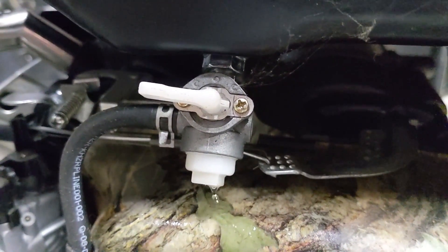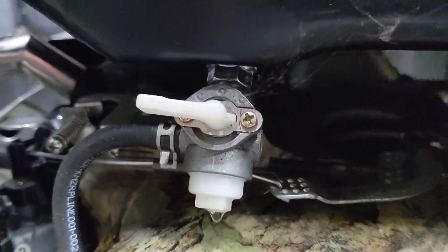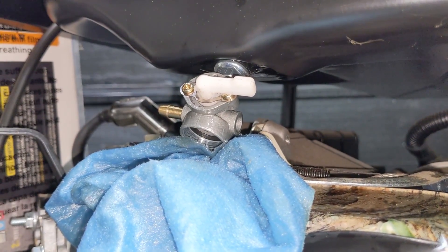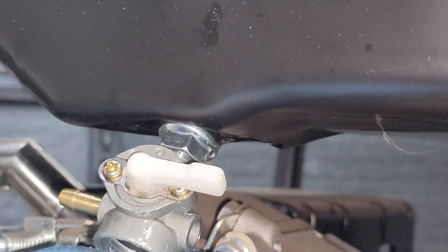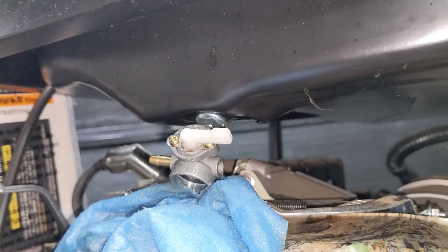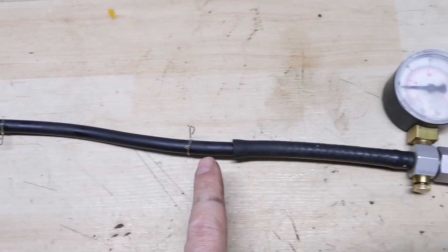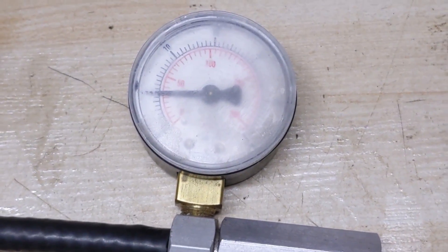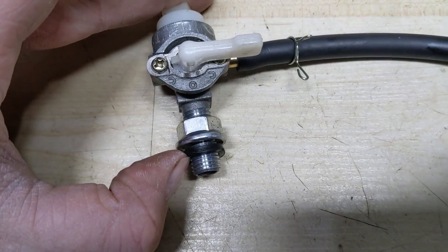Here's why we test things: I put a very small amount of fuel in and we can see it's leaking from the bottom plastic. When this thing got the impact it might have cracked the sediment bowl for the shutoff valve — not a big deal, I can change that out. Actually it appears we're not leaking from the fuel valve itself but from the area where the fuel tank connects to the fuel valve, so there could be a small hairline crack on the bottom of the fuel tank. I'm going to remove the fuel valve to inspect the bottom end.